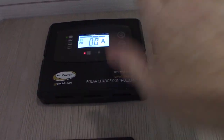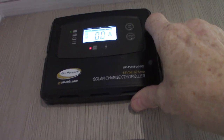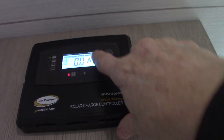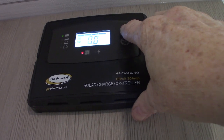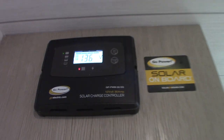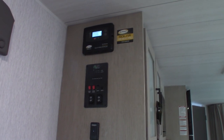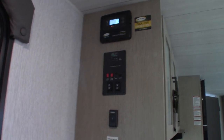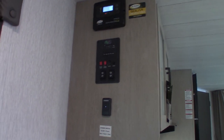Once the battery drops it'll change — it could be 4.6 amps, whatever, depending on conditions outside. You get that reading by pushing the upper button once. Push it again and you get amp hours, then 13.6 volts is what you have in your system. Keep in mind all that will register correctly once it stops flashing FUL — to get it to stop flashing, just use some of the energy in the battery.